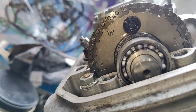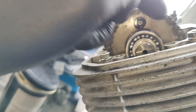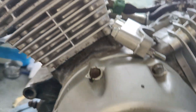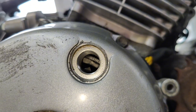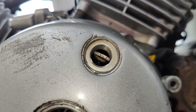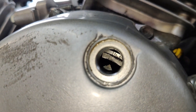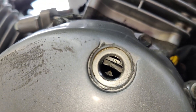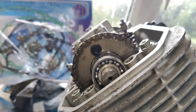Also timing — those two front and rear don't need to be flush. That's the rear cylinder. The front cylinder needs to be flush with the head, and then the marks are on here. See that notch — that needs to align with this line, an F on the front, and that's how you set it up. It will be similar for the rear cylinder. Easy.